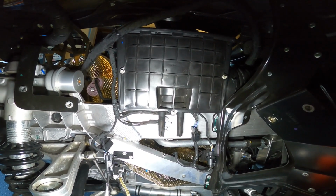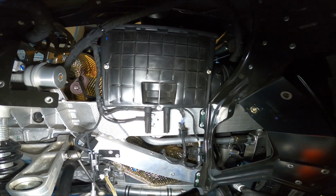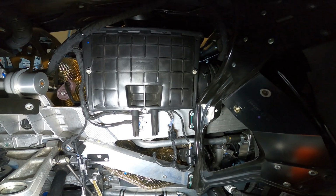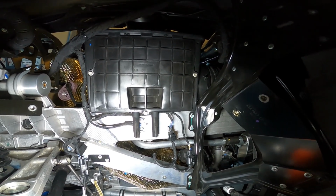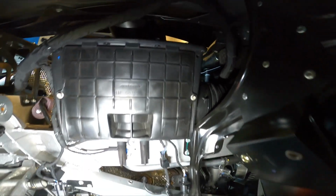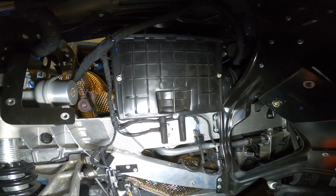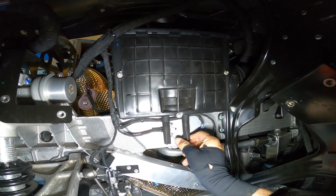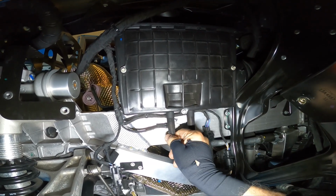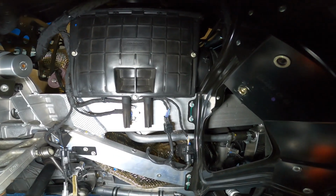The other thing I wanted to show, this is the airbox on the passenger side. You can see there's 3 screws on it, and if you remove those 3 screws, the cover comes off, and that's how you're supposed to change the air filters on these cars. You can actually do it from the top, but it's more difficult to remove all those little screws. And to do it this way, it requires you to actually pull the fender liners out of both sides. These are drains in case any water gets in there. If you pull it off, you need to make sure these are clear, with no trash in there, leaves or things that can get in the airbox.